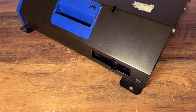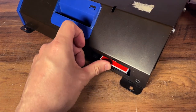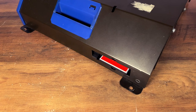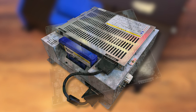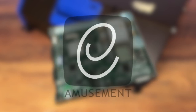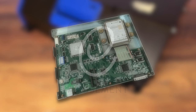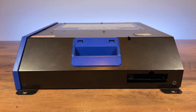On the right side of the system are the dual PCMCIA slots, although I'd hesitate to call them PCMCIA compliant — another quirk of the 573 worth talking about later. Typically these slots were used for PCMCIA flash cards with up to 32MB of flash ROM for storing game data or user files. They were also used to connect the 573 to a network unit, likely running Toshiba's Yudeos real-time OS, allowing games to connect to an early version of Konami's e-amusement network service and download content to a 2.5-inch hard drive.